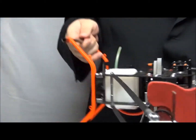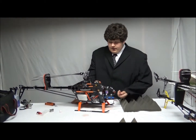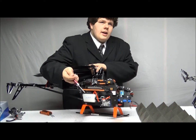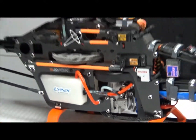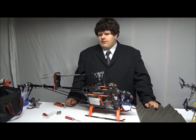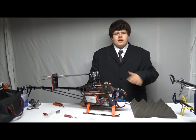And that, ladies and gentlemen, is how you put an OS motor — or any brand in particular — inside of a 600 Align frame. Now, like always, this is just me being OCD about it, but after it's all done and you start it up and do your break-in, I go back and half turn it again. Because even though it's Loctited, ninety percent of the time they usually get a little loose because everything gets seated during break-in. But that's normal — just go ahead and tighten it up again. Before I fly, I always check my frame screws and everything. I enjoyed this episode, I hope this is helpful. Subscribe, do what you please, and remember — make the First Person Review count. My name is Holden Matthias. See y'all later.